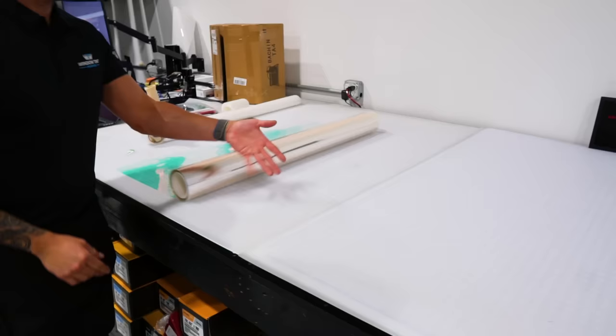The only thing with these Silverados is when you put the rope across the bottom, it's so close to the bottom of the window, it's tight down there that it's hard to get the rope out without ripping the tint out. Most of the time I solve that by heating up the window in that area and then laying it down with the tri-edge and just making sure the film's as attached to the window as possible before pulling the rope out. That way we alleviate any issues of pulling the film off the window.